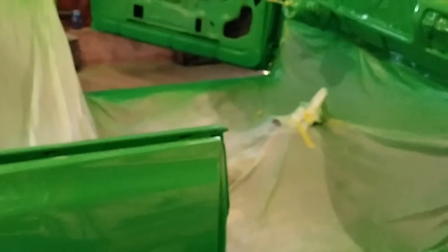I'll show you how I'm doing this. For me, the easier way is doing the back half and the door jams and the doors and the gas first, then I'm going to do the doors and the fenders. I'm going to have the hood off and do that separate, do the trunk lid separate. I have a small compressor so it has a tough time keeping up, plus it's just easier this way. I'm trying to eliminate all the tape lines, so I did the jams and everything in one shot.